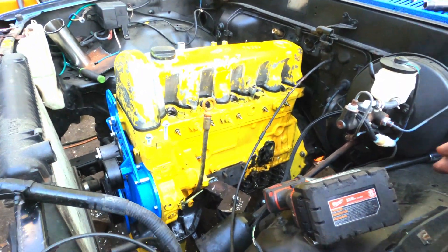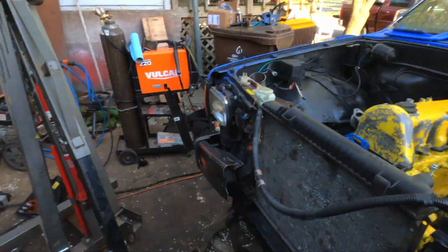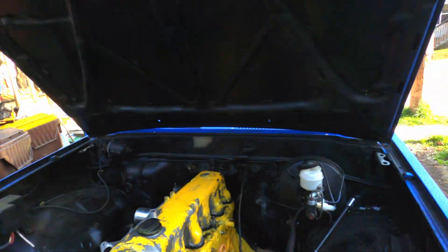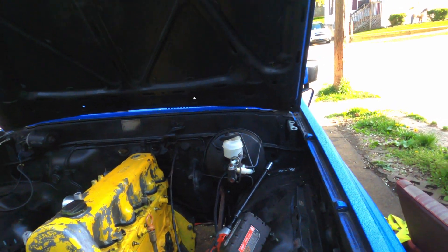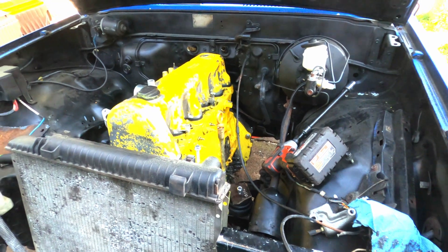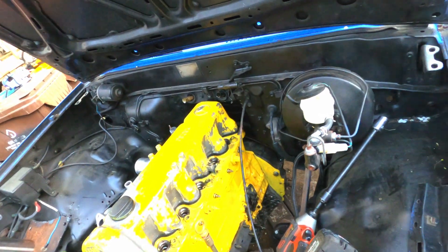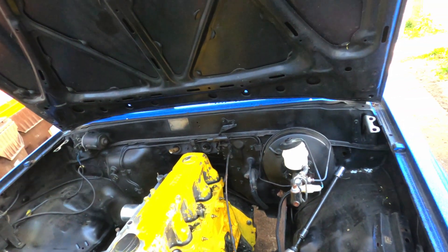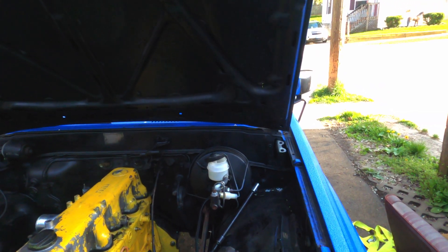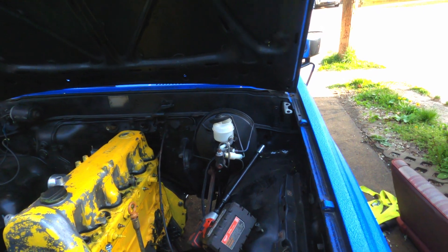Plenty of room with the Doomsday serpentine kit for fans in the front — that's cool. I'm going to throw the hood on here real quick. Plenty of room to the radiator and plenty of room to the valve cover. I'll probably go with the three-liter V6 radiator — it's a little wider and taller but I own it, so that's a point in its favor. This project is more or less done for this weekend. I'll put nuts on the engine mounts and wrap it up. Thanks for watching guys, looking forward to seeing it run — see you next time on the Driveway Engineer.